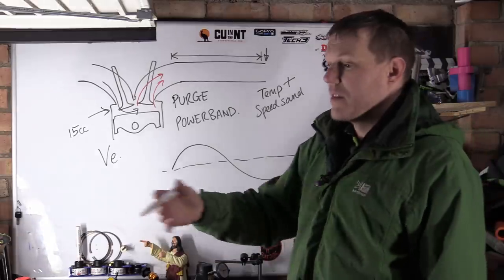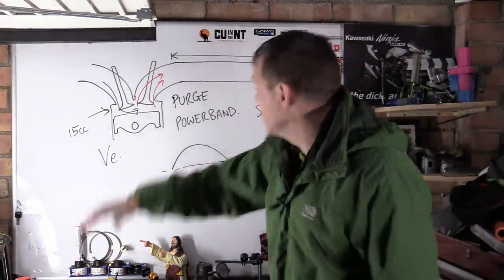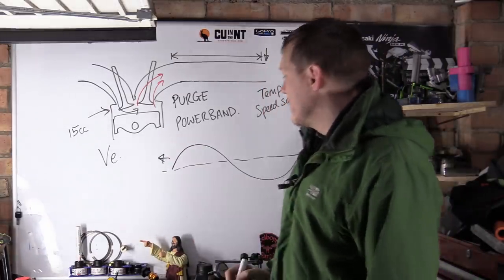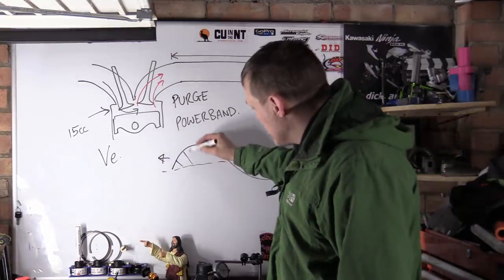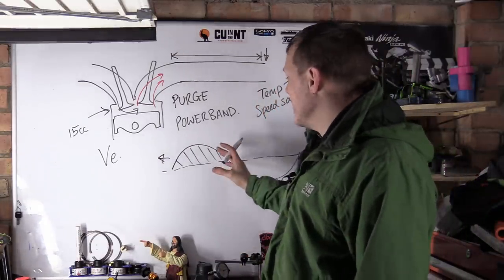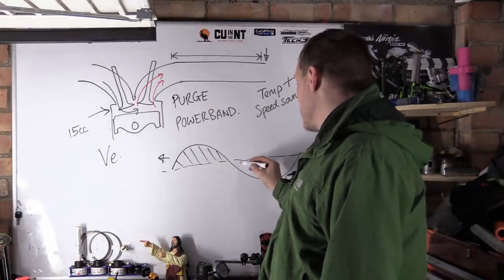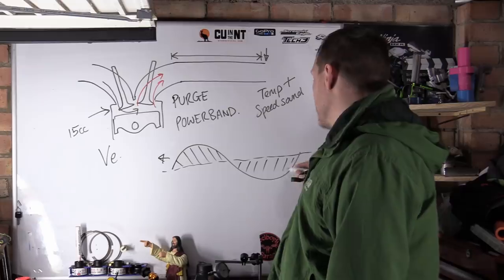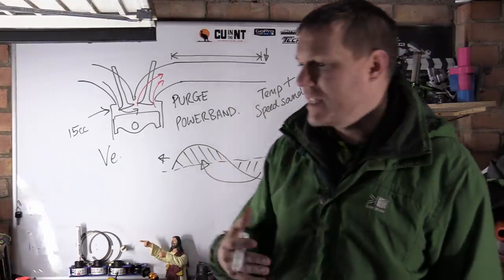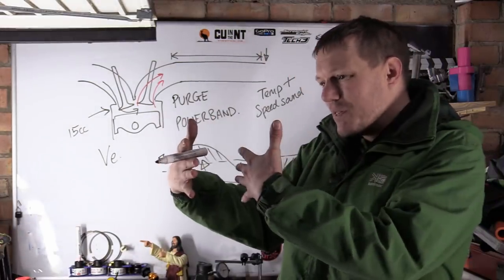This is just when there's asymmetry to a system, so in an exhaust pipe, as a pressure wave goes down the exhaust pipe, the exhaust gases are going this way. This is basically density. That's what you want to think about. The pipe doesn't bulge or anything. It's just density. This has to come from somewhere and it comes from here. So basically all these end up here. This is just density. This is what a pressure wave is. It is higher pressure, but it also means that it's denser.